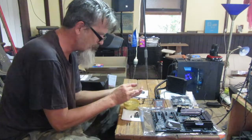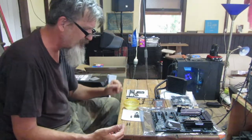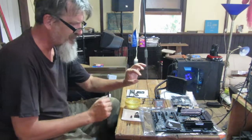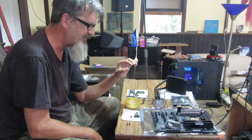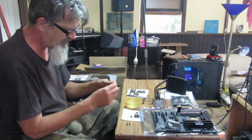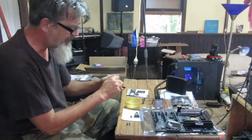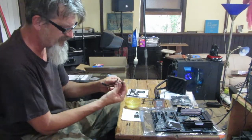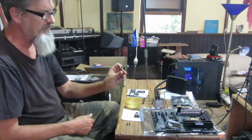There are four of those AMD-specific risers — not appropriate for Intel, so they'll be going out. All that's left are the correct spacers or risers for an Intel CPU installation. As you can see, they've got exactly the same thread on both sides — one end goes into your back plate, and then when you put the other cage on you get these thumb screws which go perfectly onto the top of them.